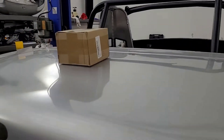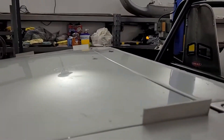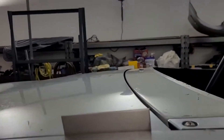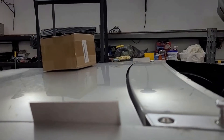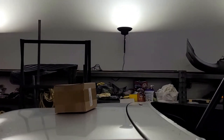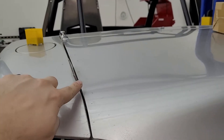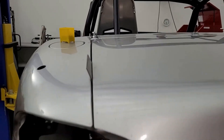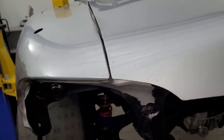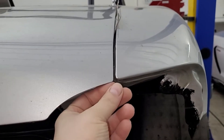I started manually bending the lid with my hands. If you put a weight here - watch this, if I lift this up - well it doesn't look that bad off camera, but it's too high. If I set this down it gets a lot better. I grabbed some spacers to try to keep the gaps pretty even. They're slightly tighter in the back here because my quarter panels sucked in a little bit - I could try to fix that, it's really not that bad.